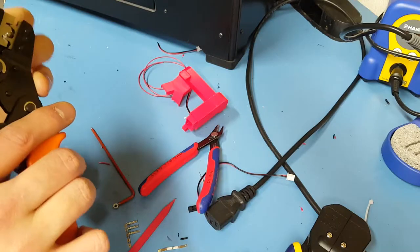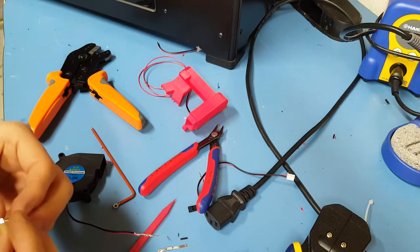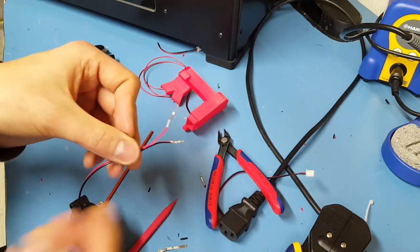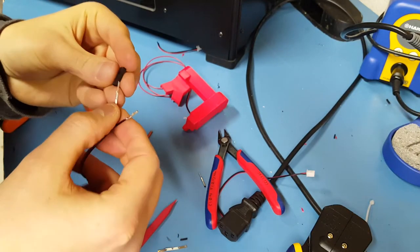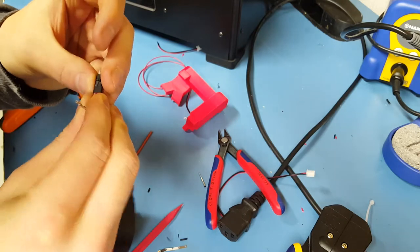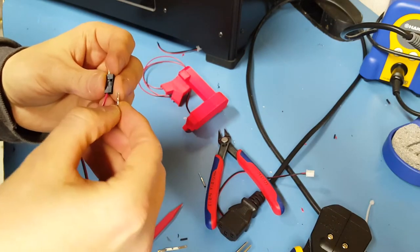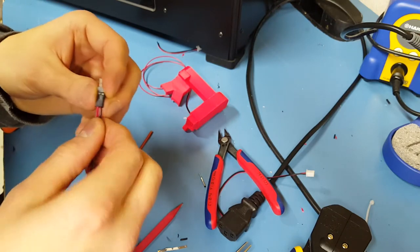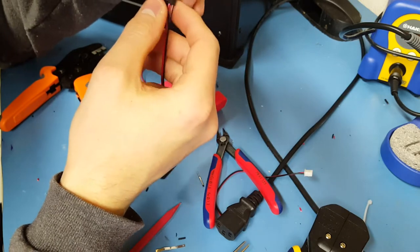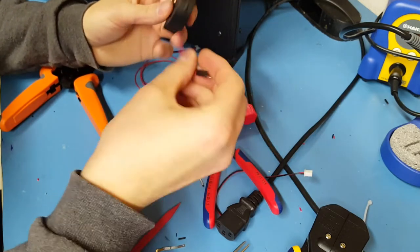You just have to line it up. Pretty good connection. The other end is exactly the same process just with the female connector instead of the male connector — I think the easiest way is to line it up in the tool first. Once both ends are done, it doesn't really matter which way you put them in; this side with the little square just needs to line up with the little blank area. I use my pliers just to bring it up into the little detent. There we go — one connector done. The reason I do both male and female like this is just to make sure you don't mix up polarities or flip them around, making it a lot easier to reinstall them.